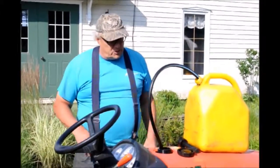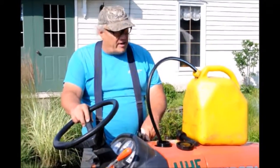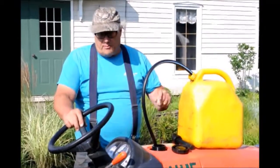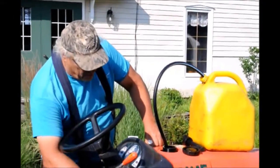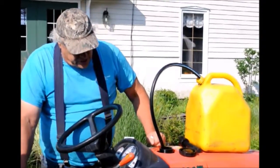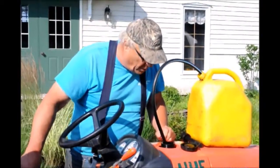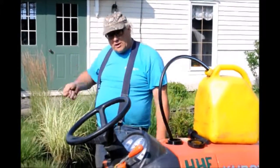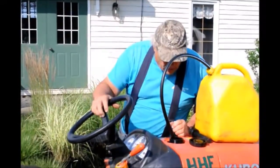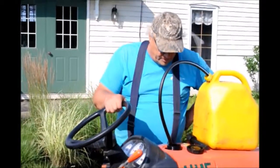The advantage of doing a siphon this way is when this tank is empty — I know it takes about five and a half gallons — I can take a five gallon bucket and put it in and it won't overflow. But just in case, I turn the ignition switch on to see the tank level as it's rising, and I can easily monitor it. It's not like I have to stand ten feet away and crank something, then come running over to see if it's overfilled or almost filled up to the top.